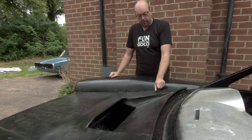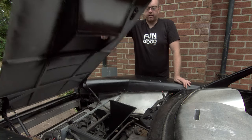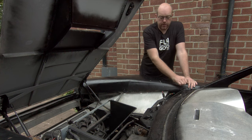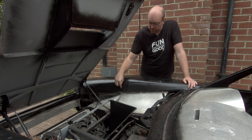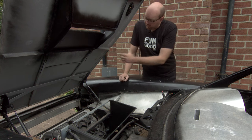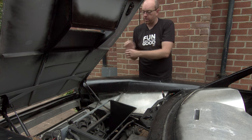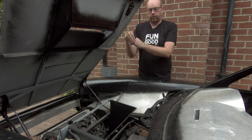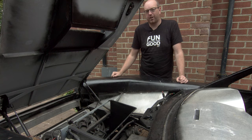As you can see now, when you release the bonnet, it's a very marginal flex that you need to put on the corner, rather than really having to lean into it to make it work. In order to try and get that flex spread across the entire bonnet rather than being focused around this particularly weak spot — where we still need a gap to go around the lower spar that comes out to the wing from the inner structure — we're going to put another small piece of angle bracket in. Instead of having it coming down the side, we need this hole, so we'd have to take so much out it would be pointless. We're going to flip it around the other way — being a diagonal brace, inboard we have a little bit more room for it to clear. So we can put something in, join it onto this spar, weld it on the underside of the bonnet, and maybe then fix the paint after we've done all of this welding.